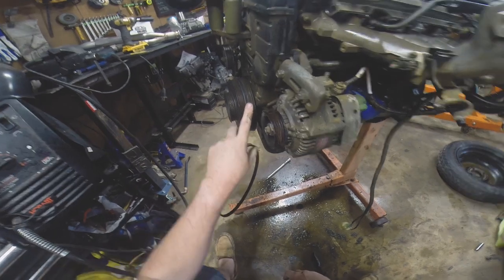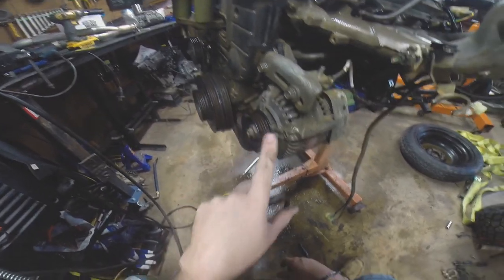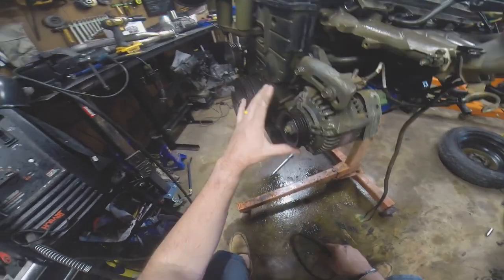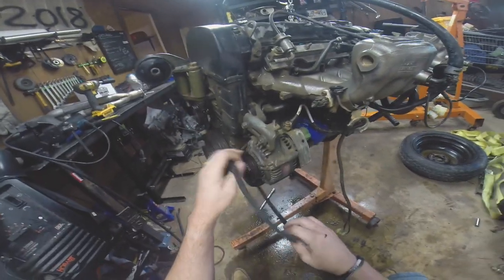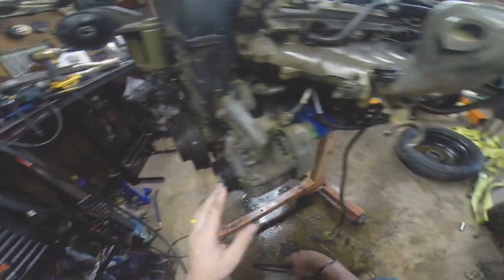This side of the motor — forever it was running a four-rib on the balancer and only a three-rib on the alternator. What I would do is put a four-rib belt on it and it would chew it up until it turned into a three-rib belt, and it worked. But I want to go ahead and make sure that it's taken care of while it's all apart — little things like that are definitely on the list.